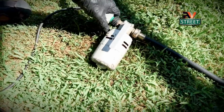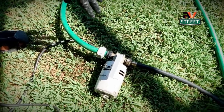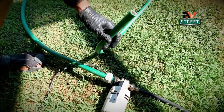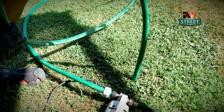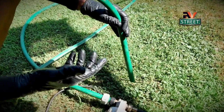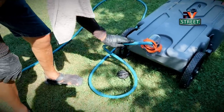Here's how we're going to do that. I have here a 110V transfer pump and I've already tested this — it draws a lot of water really quickly. I attached a long green hose here as the pickup hose, and what I'm going to do is feed it down the toilet, down into the tank, and hopefully even down through the bottom part of the tank and down into that 90. I'm going to try to suck out as much water as I can. This is the discharge hose — we'll be putting the black tank water into here. Let's get started. I'll show you how I'm setting this up.